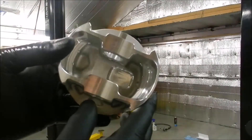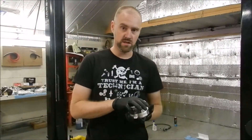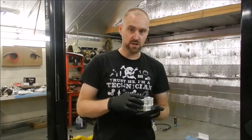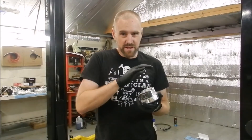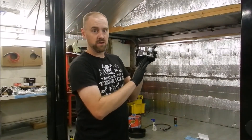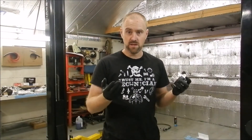Then we have this one here, and you'll notice something different — see where the mark is. Notice the mark is shifted this way. So when he balances these things, he goes to the extreme of not just setting it on a scale going 'okay, I need to make it X number of weight.' He actually takes the time to hold one end up and set the one end on the scale to see what it weighs, and holds the other end to see if there's an unevenness to the piston. He'll actually take the time to counter it as much as he can realistically to make sure that when it gets pushed on the wrist pin, the centerline of the wrist pin isn't going to have extra weight on one side — which would make it harder to push up on that side, causing skirt wear. So he tries to make the skirt wear minimal. He goes to the extent of balancing that well. That's why I like to use this guy — he is really precise with his work.